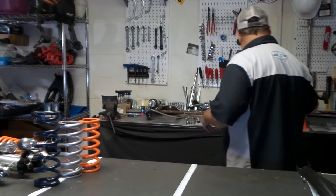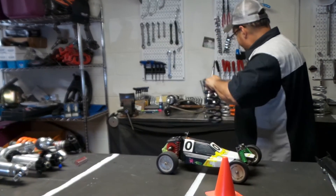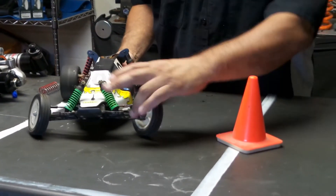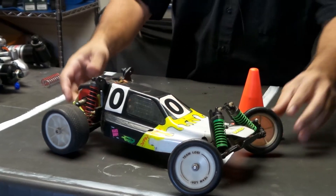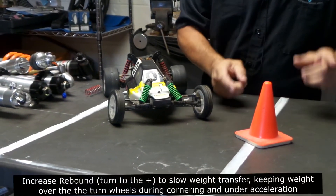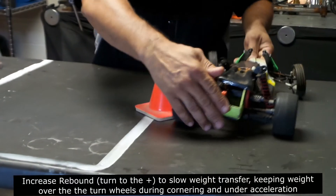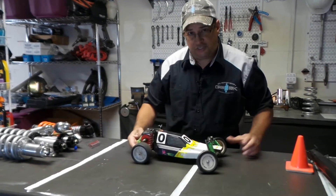Here's the fun part — why do you want all these adjustments? We'll break out the toy car. You've got your new double adjustable shocks on, you're coming into the corner, you turn and hit the brakes, and the car pops up and pushes — tires skipping, you have to slow way down. That happens because all the weight pops back up. Turn your knob, add more resistance, and that keeps the weight down longer. Now you can come into the corner, the car stays down, turns better, and comes up slowly on the way out.